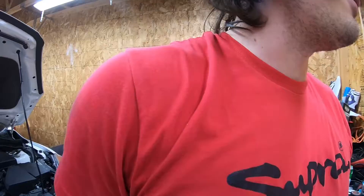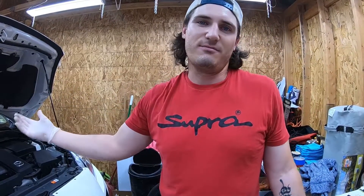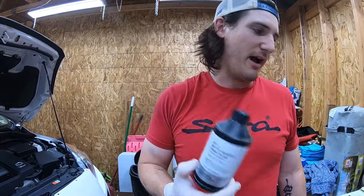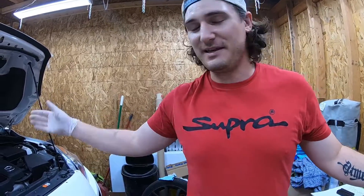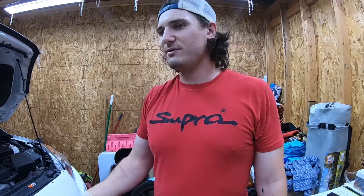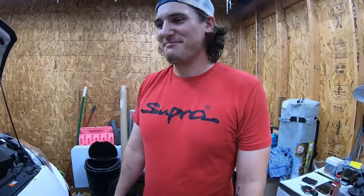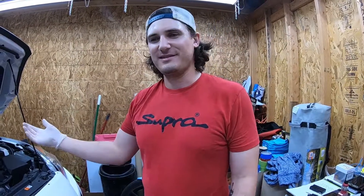As far as how much brake fluid you need — considering we couldn't evacuate all the dirty fluid from the reservoir, we pumped more than we would have otherwise. We used three 12-ounce bottles, literally emptied them, and it was perfectly at the max. Three 12-ounce bottles is what we ended up using, and it looks clean in the reservoir now. I used brake cleaner after finishing each caliper and sprayed the caliper down, because a little brake fluid gets around when you remove the hose. It's always good to clean it so you don't question whether it's leaking later on. Thanks for watching — please like the video and subscribe to the channel!